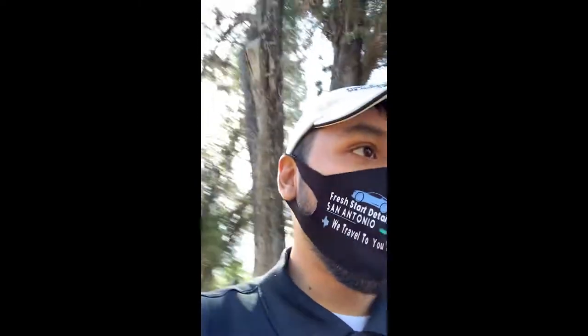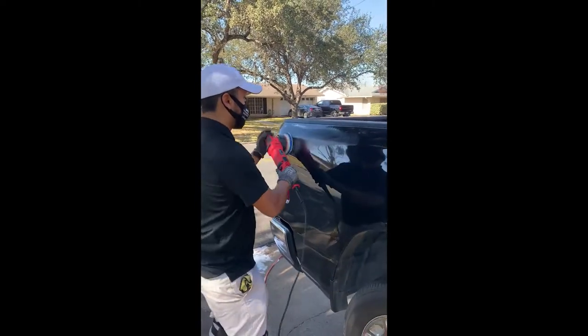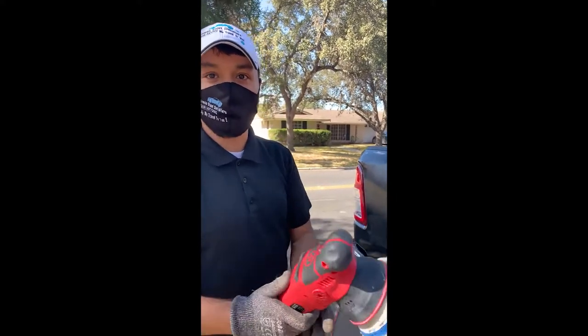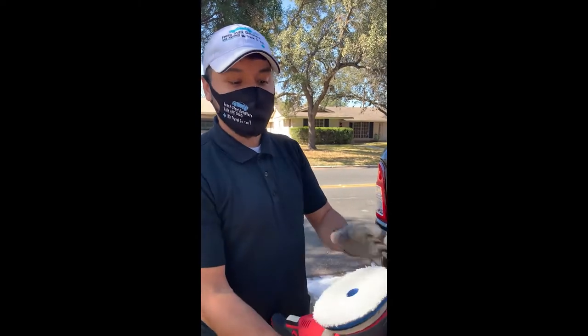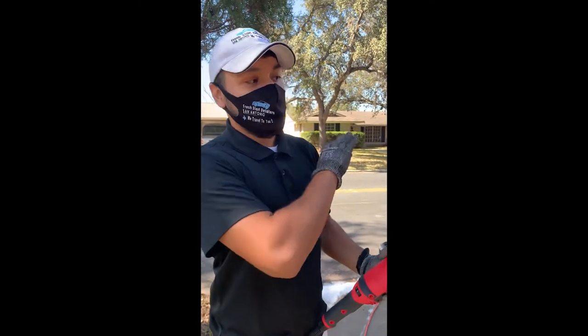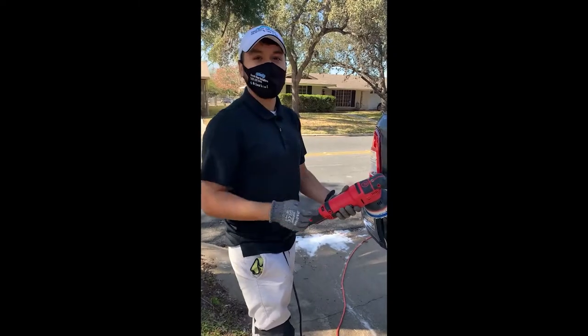There are some defects on the paint that I mentioned earlier that the customer is concerned about — he pointed them out to me specifically. I'm going to start compounding the paint, working from the back on the hottest side where the sun was hitting a little bit more, to get that out of the way. When you're using a DA polisher, you want to spread the product out on setting one, work it out, apply a little bit more especially with a clean pad, then move to what I recommend — speed four and a half — going left to right then down and up, which is technically one pass.